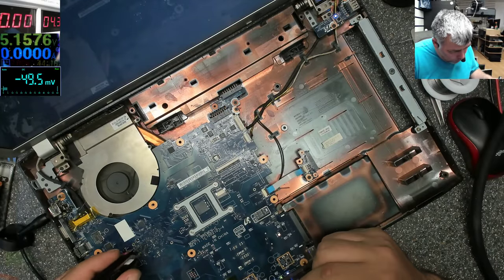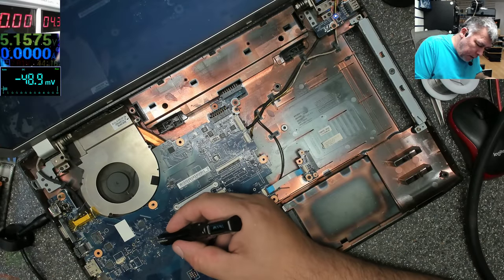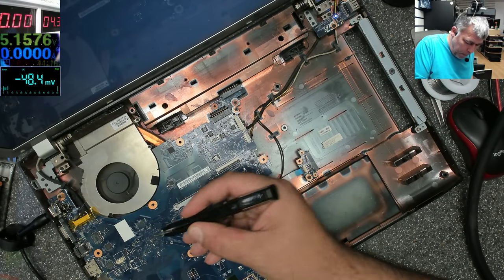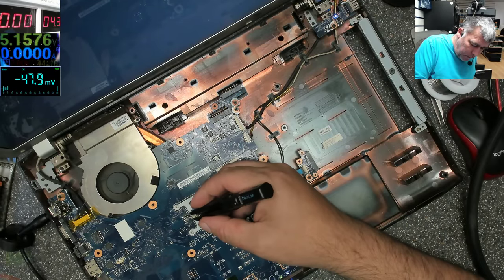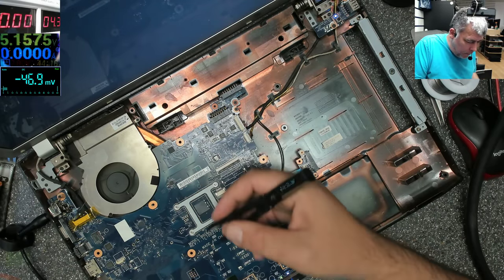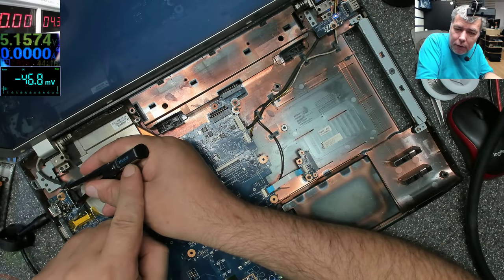The voltage. So here probably is the chipset. And on the chipset, 1.4 volts. Hopefully you can see 1.4, yeah? What we can check, the processor is 0.9. You can see 984 millivolts. The input voltage, you can see 19.2. Hopefully you can see.